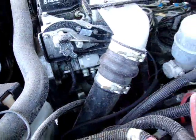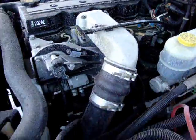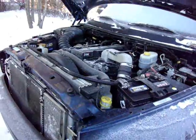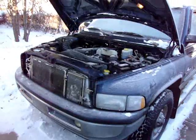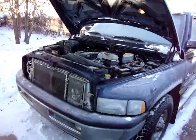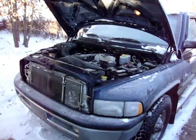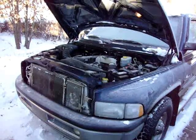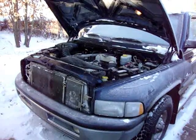The plan is to change out the injection pump with a remanufactured version, but to prevent any possible issue of fuel starvation to the new injection pump, I am also changing the lift pump. I already performed a fuel pressure test on the low pressure side and was getting lower than required pressure — the VP44 requires a minimum of 4 pounds. Today I will replace the factory lift pump with an aftermarket FASS system pump, purchased at JP Automotive for $321. This pump is rated to supply 70 gallons per hour at approximately 18 pounds of pressure.